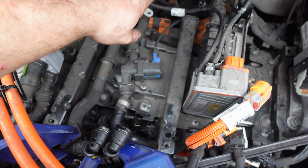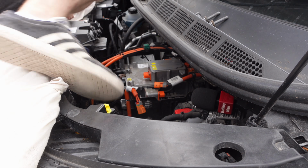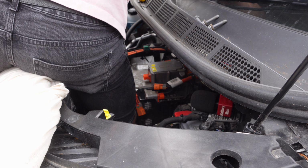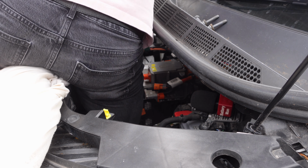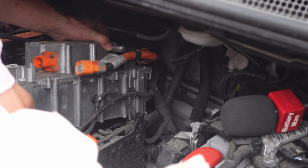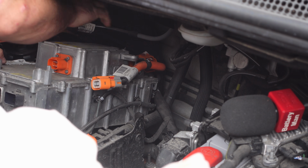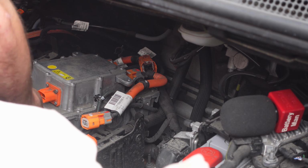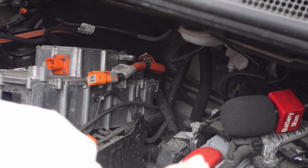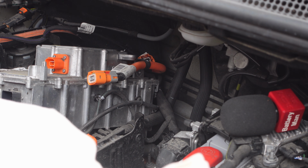I'm sure that this is probably easier in the cars, but in the van, the whole unit is tucked low and it requires you to crawl around, getting it in behind the bulkhead area. One of the challenges is that the back of the unit has a number of cables clipped in place. It can be a bit of a challenge to pry these off. If you've ever taken a door card off, you know what I mean. But just go easy and they'll all come off without breaking anything.